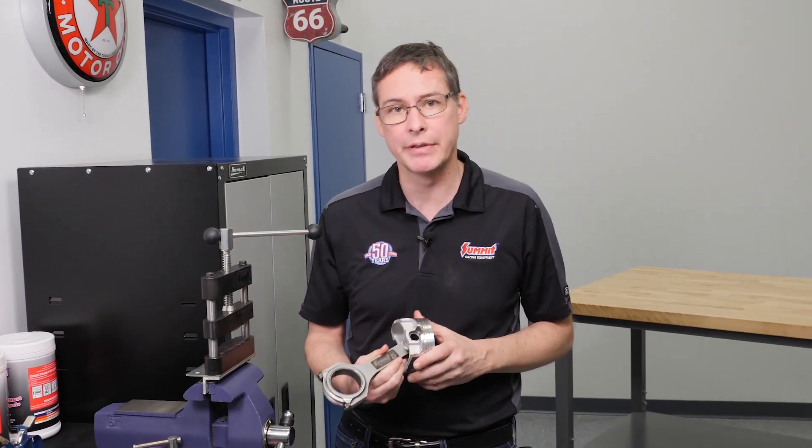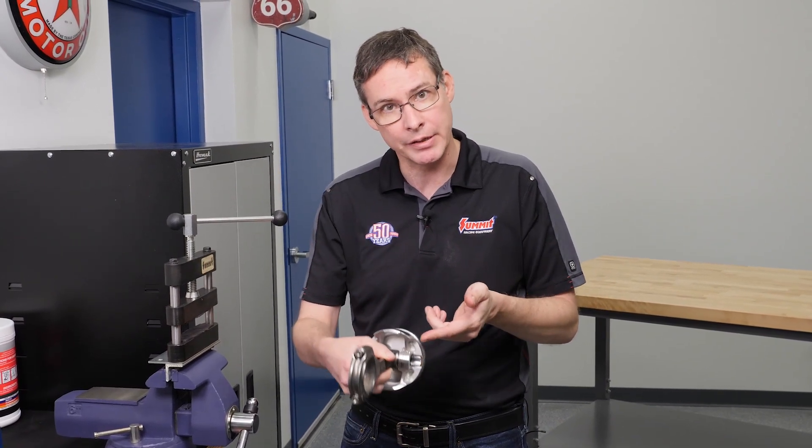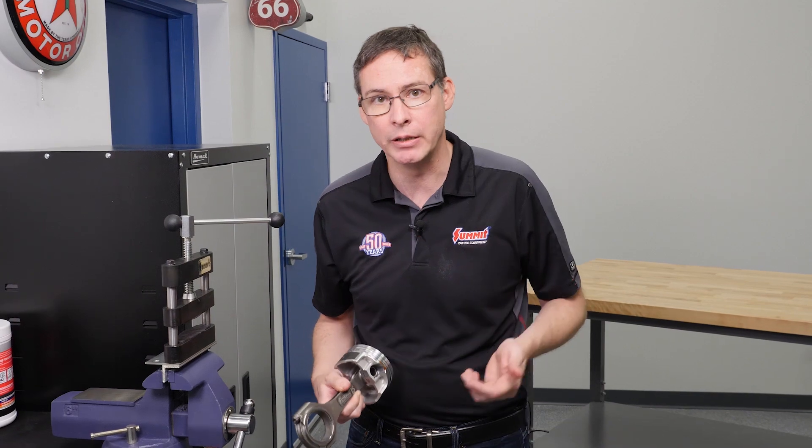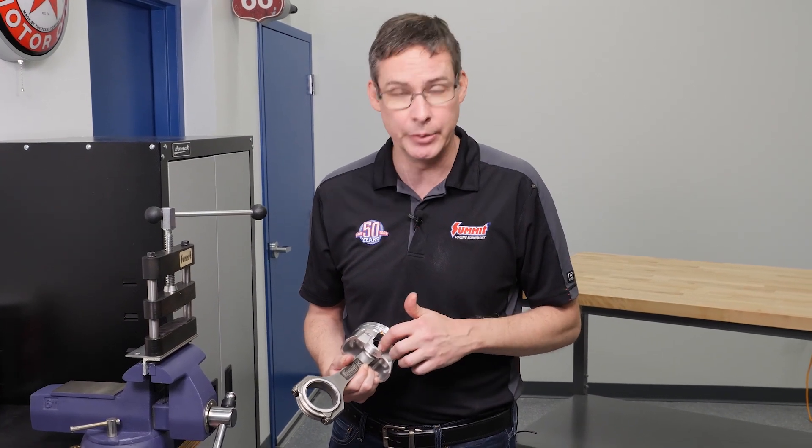So we've got done with seven out of eight pistons. You'll get into a rhythm with this type of deal. The first one might take you 20 minutes and you might be swearing a little bit, but by the time you get done with your third or fourth spiral lock, you'll start to feel how it works. Keep that thing at 12 o'clock so you can wind around and have a little bit of leverage. Remember to push down and pull up on the opposite side around its rotation — that'll make your life a lot simpler. Now we've got something that's basically bulletproof. That pin is never going to leave that piston through that spiral lock without us going through with a pick and pulling that spiral lock out when we rebuild the engine. Be sure to like and subscribe to get more of our how-to technical and installation videos.